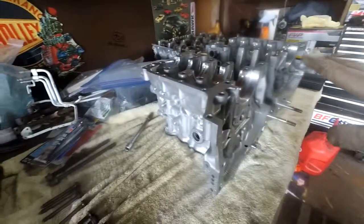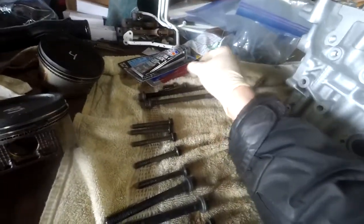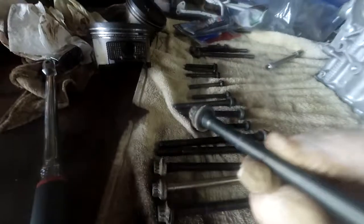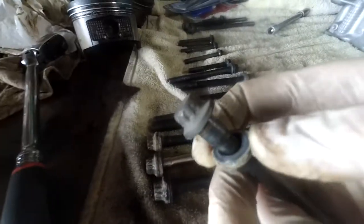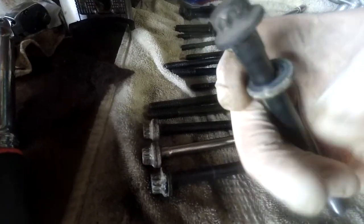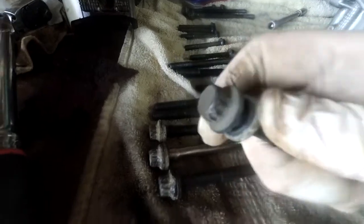Alright, got the block split apart — pretty easy. Now I just gotta clean everything. There are 18 bolts total if you include the little 10mm underneath in the oil galley underneath the oil pan. Some of the bolts are a bit special — these have a washer with a gasket because they live inside the coolant galleys. You need to make sure you go to your Subaru dealer and get new washers that have the rubber gasket built in. I got new ones for those.